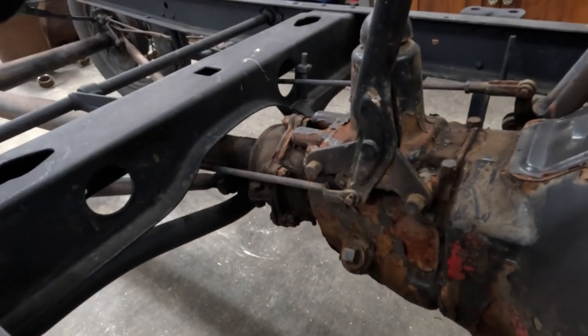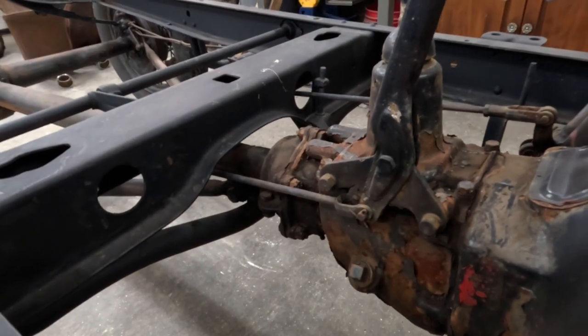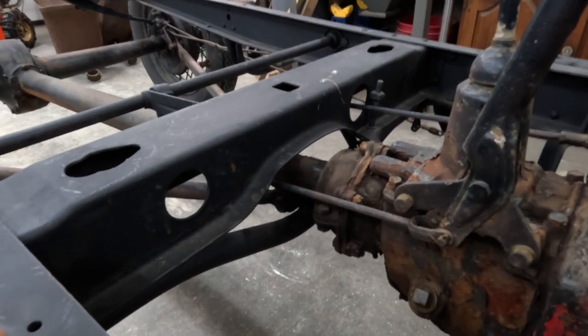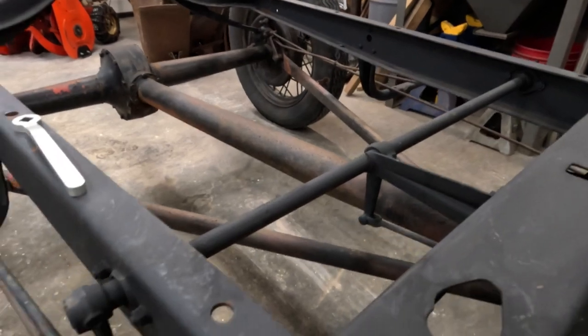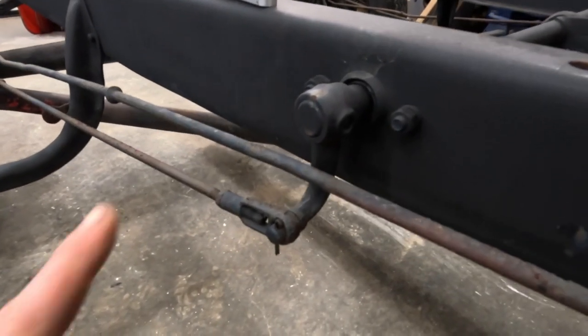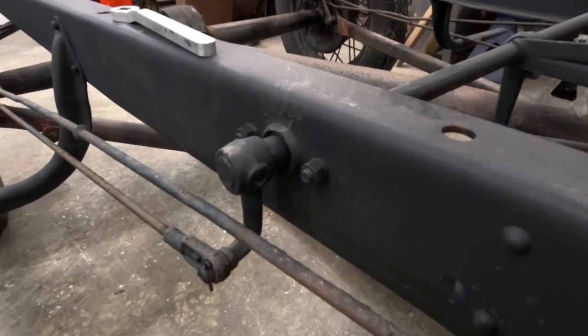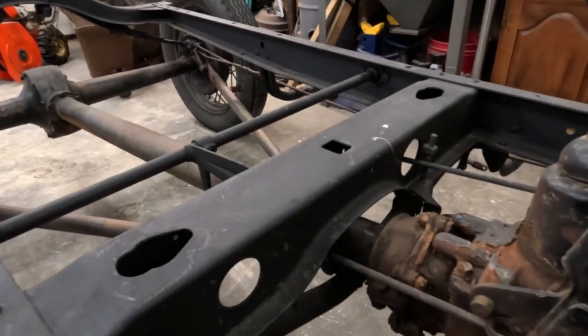Here's the emergency brake lever, and you have the rod that runs back to the emergency brake shaft — similar to how your service brake shaft is set up. But again, Model A's were the only ones that had a whole separate system. This is your emergency brake shaft, and it works the same way where the shaft rotates and pulls on that arm. In 1932 they went to a system where the emergency brake lever just actuated the normal braking system.